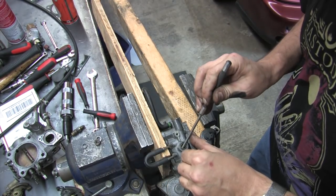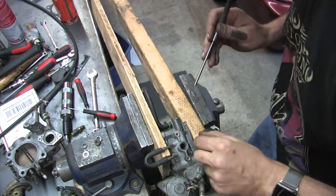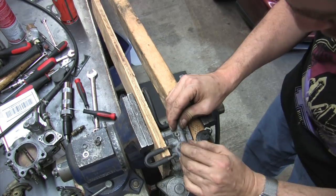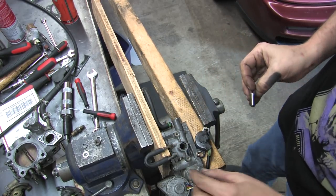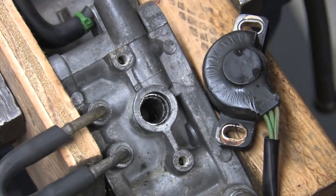As you peel back the onion, there's a stack of washers and seals inside this thing of different materials and they're arranged in a specific order. Under the E-clip, there's a plastic washer, a metal washer slash spacer, and the original factory mil-spec seal. When I bought the parts to rebuild this thing, I was expecting it to have the same seals inside it, and boy was I wrong. There's two seals, and they're different, one smaller than the other one.